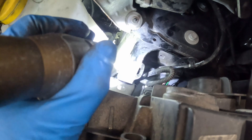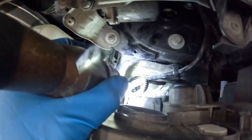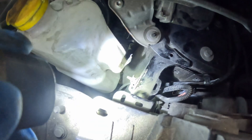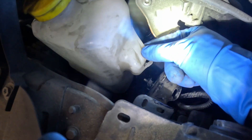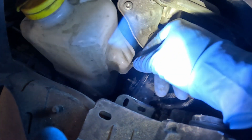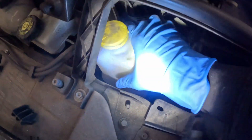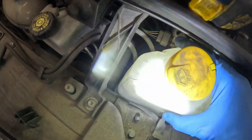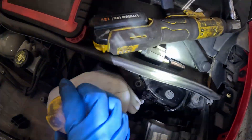After trying to unscrew it, mine actually just broke off. It's a really cheap bracket. It looks like it might be able to be slid off or pushed off, but the screw was not going anywhere. You can try pushing the pump out and trying to free it, but mine didn't go well. So that's okay — we'll put a hole through and do a little zip tie or something to hold it back in place. It's not a big deal. After that, we can just push it up, disconnect the sensor here, leave these lines on, and wiggle it out.